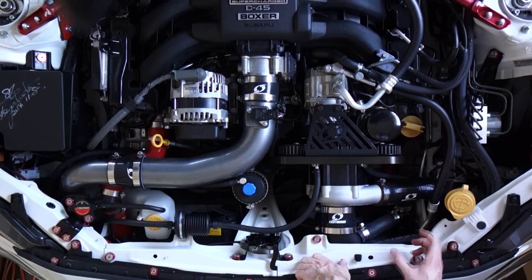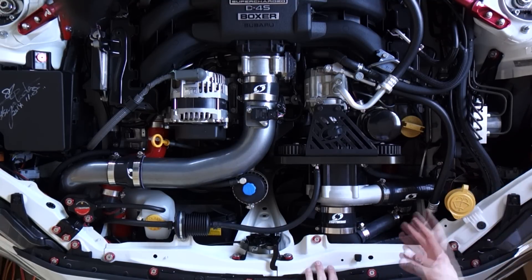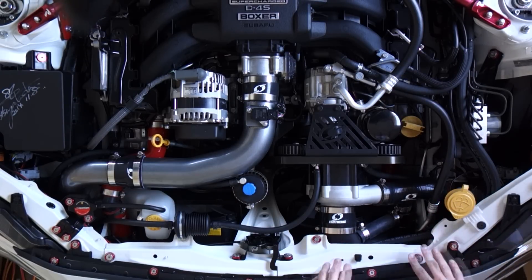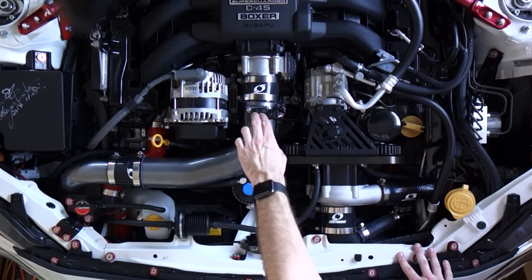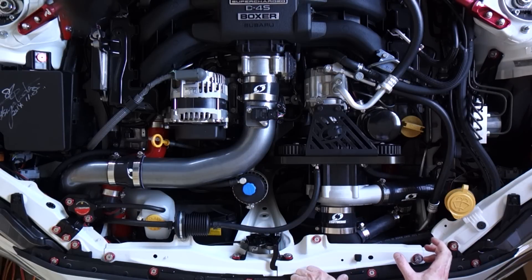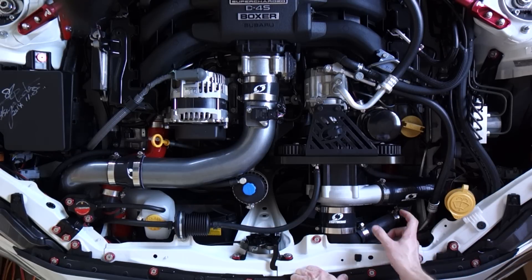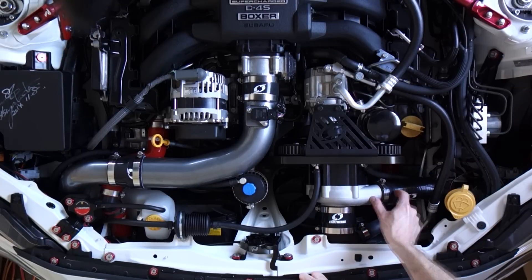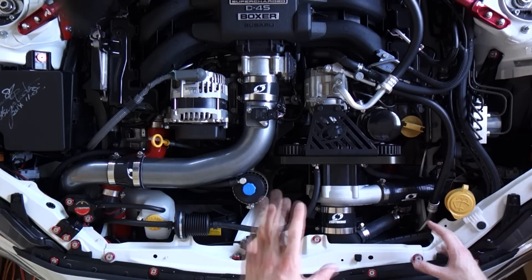What you can do is tune the car to compensate for that. If you know you're going to be running an atmospheric blow-off valve you can adjust your tune so it compensates for that lack of air even though it's being measured. Tuners don't always use this sensor in their tune either. Speak to your tuner to figure out exactly how they've tuned the car to find out whether it's going to be appropriate or not. But the important thing to remember is that if you're running a factory tune and want to fit an atmospheric blow-off valve, you need to make sure your airflow sensor is after the valve. If it's before the valve then you're going to have problems running too rich when you lift off the throttle.